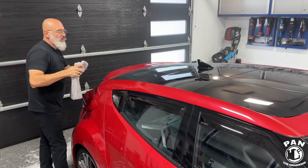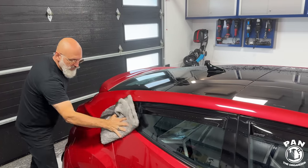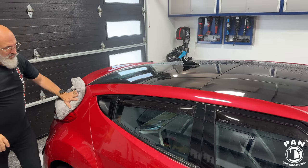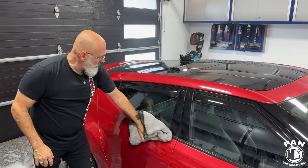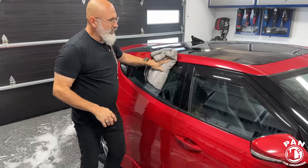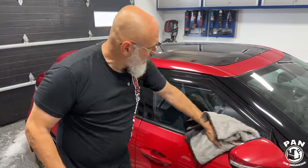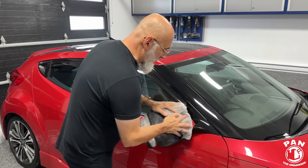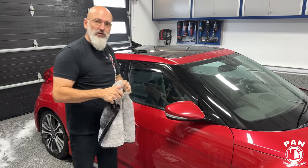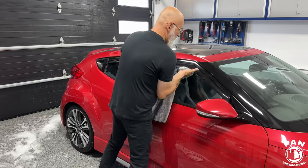I also noticed that usually iron removers smell like rotten eggs because of the TGA that's in there. Right. Because chemists don't want to deal with it. It's the inherent nature of it. But I smell pretty much nothing now in the garage, and usually the garage is filled with the smell for at least a few hours afterwards. So that's the advantage because you're using a lot less, right? Right, so instead of using 8 ounces of product, which is the average usage for a car if you're spraying it on, we used about 1/2 ounce. So you're saving a lot of product.